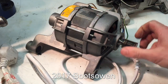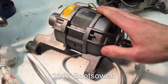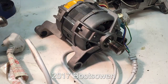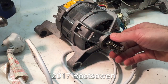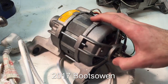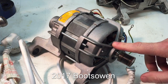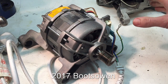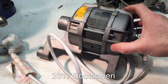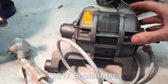Over here on the left I've got a three-phase type induction motor — this one is a washing machine motor. You'll notice the mounting arrangement is exactly the same. On the motor swap video I put up for the Hotpoint Aqualtus, which this came out of, I just swapped it for a universal motor. Why would you choose one of these over one of those? Well, the simple fact is it's lighter — this one has less copper and less aluminium in it. It's about a quarter lighter; this one runs at about four and a half kilos and the other runs at about six kilos. So you're saving on materials, transport, and storage costs — a kilo of copper and aluminium is a lot, and that's a big saving for the manufacturer.